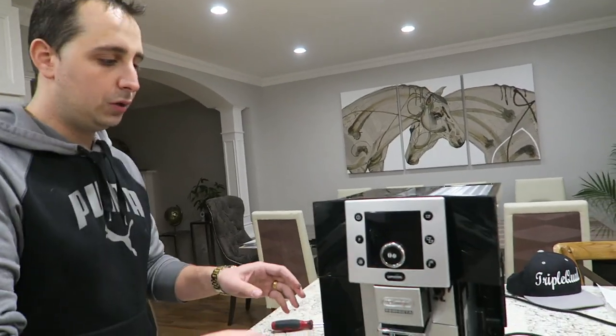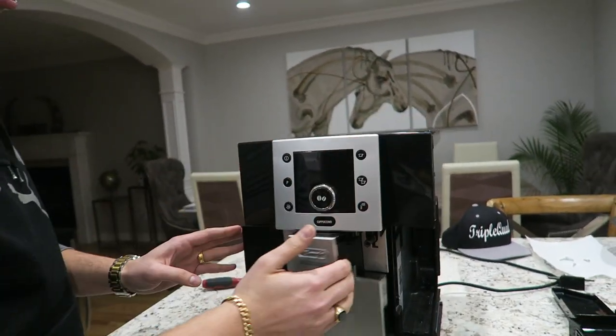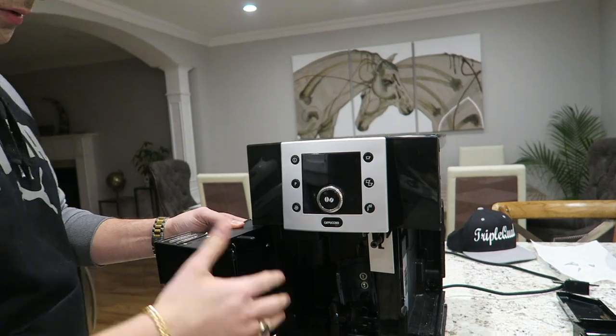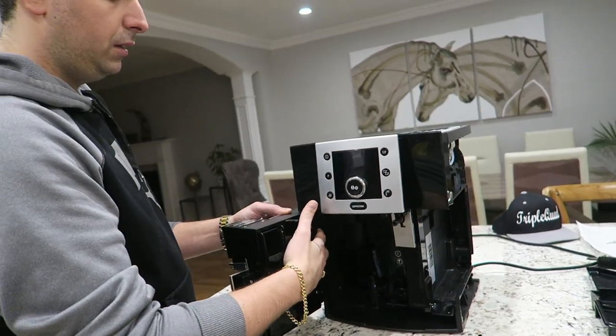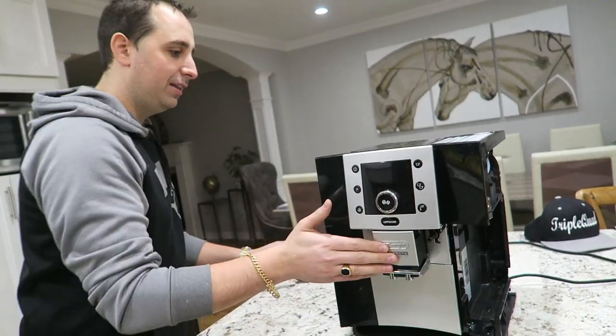Correct. So to be able to take out the front door, believe it or not, the top panel has to come out. You could try to do it just removing the screws, but you're giving yourself trouble. Don't do it. Remove this front panel. Put it that way. So pretty simple.